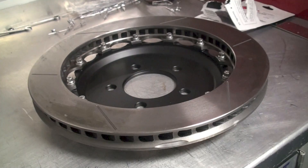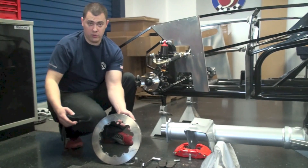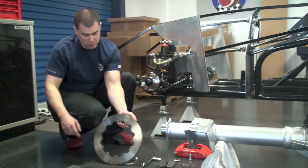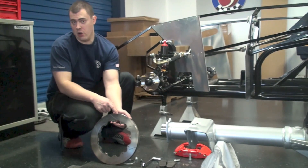For this instance, we're going to leave that out since these brakes need to go back on the shelf. Now take note when assembling the rotors that there is a left and right side and they are marked with a directional arrow, so you know when you're mounting them on the car which side they need to go on.